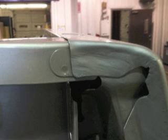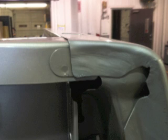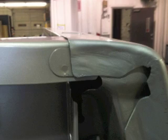Now this makes it a little bit more difficult whenever we're replacing it again, because as you can see those grind marks, but we don't know exactly where the center of this weld is. And we need to know where the center is because that's where we need to drill. So it takes a little bit more time trying to determine where exactly these welds are. In this photo is just some other areas you can see that's been ground, and you kind of see where it has been welded. But again, finding the exact center is a little more difficult.